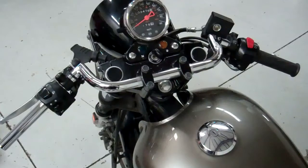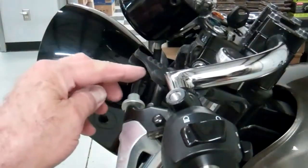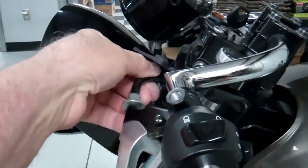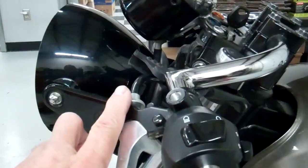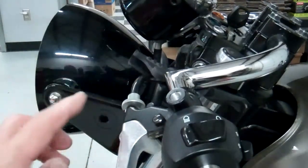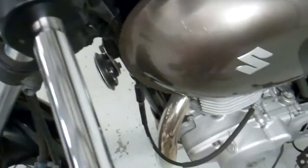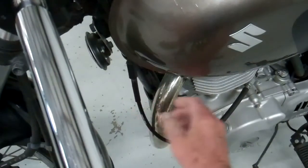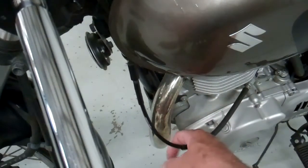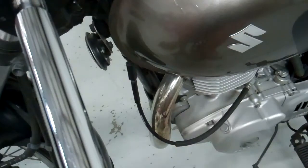I think everything's about finished. All we've got to do is put this grip on this side. One last thing about the clutch cable: you can move it up and down from below to adjust it. What you want is the most straight angle of this metal housing coming out of the brake lever — make sure that comes out as straight as possible by adjusting the slack up and down on the clutch cable. Also make sure the cable doesn't get too close to your header pipe. You may want to tweak this bracket out underneath — make sure it keeps a good distance away from your header pipe.